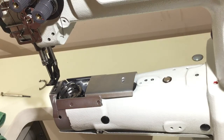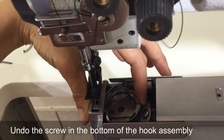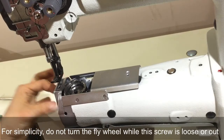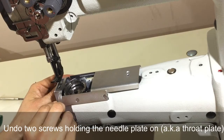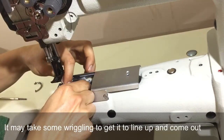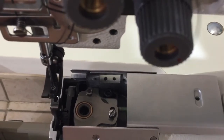If it continues to be jammed, this screw here can be undone and the whole hook assembly can be taken out. To actually take this whole hook assembly out, you'll need to undo the screws in the end of the cylinder here and take the needle plate off. Then you can have a look and make sure there's no threads or any remnants of anything left in there that will be restricting the movement.